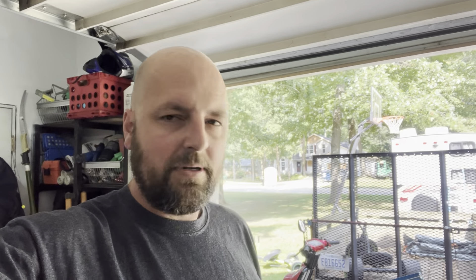It's a 2020 and I know it's never been redone, but if you know anything about an RV, water is your nemesis and the roof is the main culprit. They recommend from what I've read, every four to five years going through and resealing. So I picked up some Pro-Tech RV roof sealant, self-leveling.